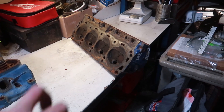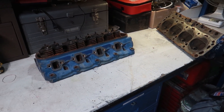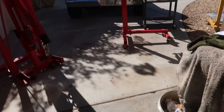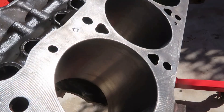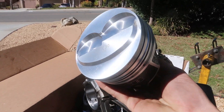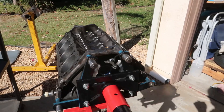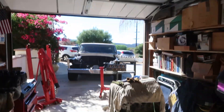I'm gonna basically just time-lapse through this real quick. You guys saw me do the detailed refresh on cylinder heads with the white Galaxy. I'm just gonna blow these things apart, clean them, put it back together and run it. I have no time right now — it's about 10:30 at night and I gotta get these done by midnight, both of them done, painted and put back together. We've got our cleaned-up block — everything's clean and new, you can see cross-hatching in all the cylinders. This is a 30-over block, the original block out of my truck. We got all the Keith Blacks pressed on — these are all 30-over Keith Black 5cc domes. I'm gonna get this thing slapped together, get the crankshaft in, put the bearings in, flip the motor upside down and get the short block assembled.